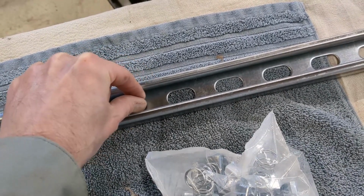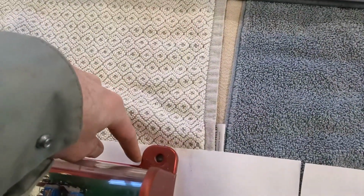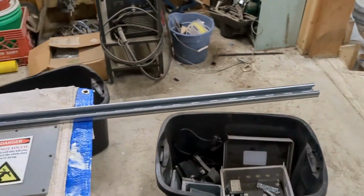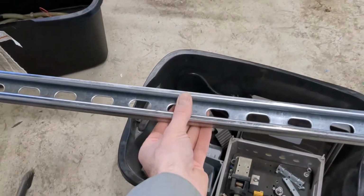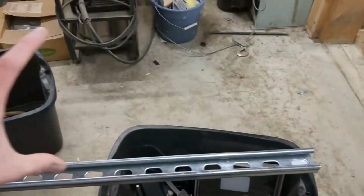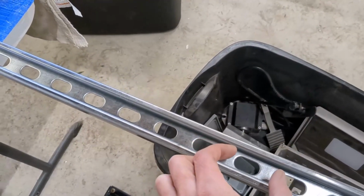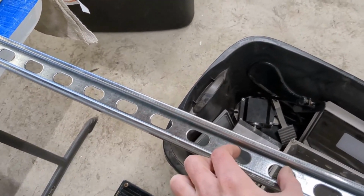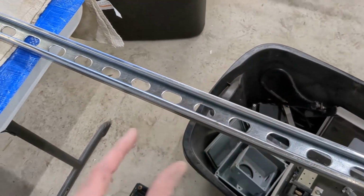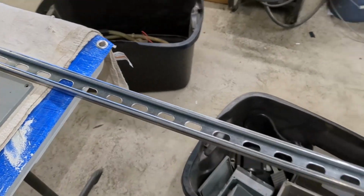And then, but it stays kind of where you want it to go. And then you can screw in mount your hardware to that. In plumbing and electrical, a lot of times these are used horizontally like this, where you would have threaded rods that would hang it in like a joist bay or something, and you can do, like I said, those nuts. You can also do threaded U rods for running conduits, organizing your conduit or your plumbing across it and holding it in place.